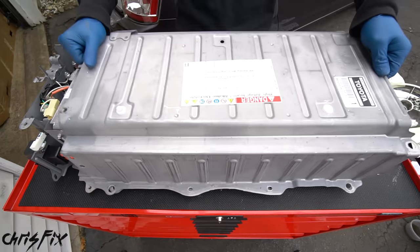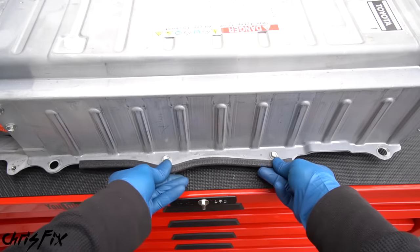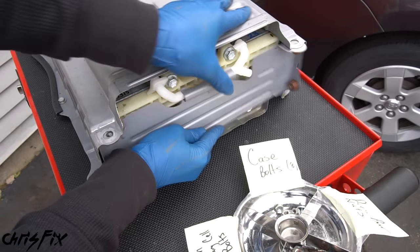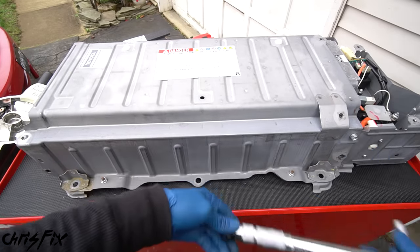With all new bus bars installed, mount the bus bars onto the battery and tighten down the bus bar nuts — which have been soaking in vinegar to remove corrosion. Drain and dry the nuts thoroughly; you don't want any moisture on here. Torque each bus bar nut to 60 inch-pounds, then snap in the plastic bus bar covers. Do both sides, then put the case back on over the battery and torque down the four bolts on this side to 71 inch-pounds, put the sharp edge protector back on, put the side cover on, torque that bolt to 71 inch-pounds, and torque the three fasteners on the back to 71 inch-pounds.